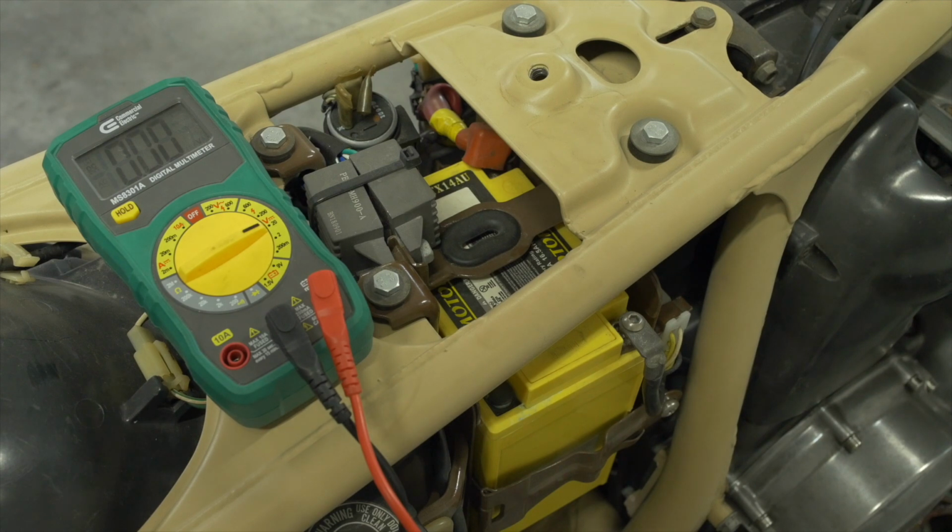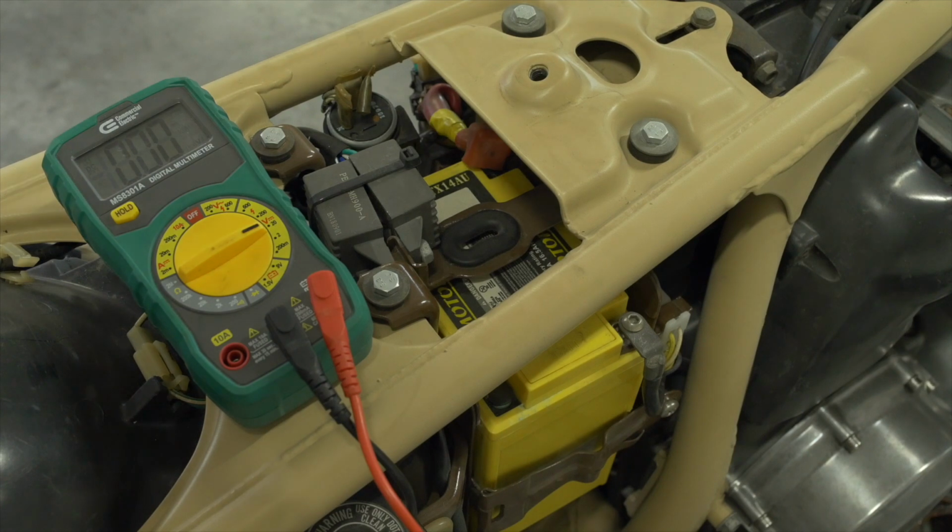And it's hard to recommend a battery. I've gotten bad ones from this brand before. Sometimes that depends on the date of manufacture, how long they've been sitting on the shelf waiting to be bought. And it's somewhat unfortunate that buying a motorcycle battery feels like somewhat of a risk. Anyway, I will say that this battery or a similar AGM style produced by Bike Master, for example, is another brand, that's going to be closest to the OEM specs for this bike. I can't recommend the lithium style batteries unless you're doing a greater overhaul of the charging system. I think they have different needs in that regard, but I can't speak to that because I'm not an expert.